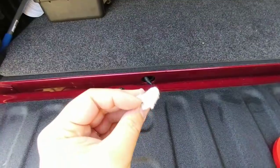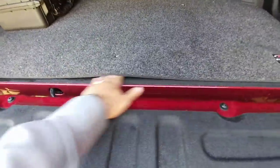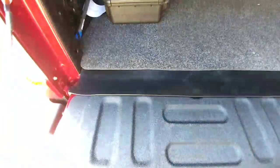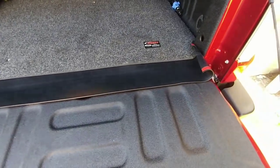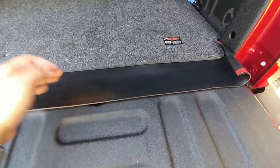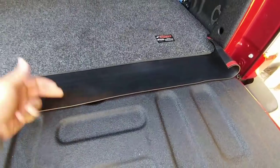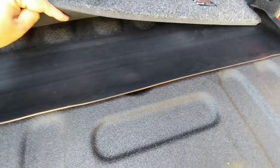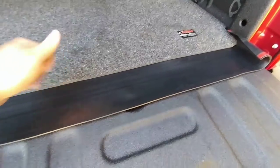Now I've unrolled the Rock Block so you get an idea of what it's going to look like once it's down. It's essentially a membrane that fills the gap here, preventing this hole from being exposed, thus protecting the paint as well as keeping things from falling back there. The 3M tape is on this side — it's going to extend all the way out about an inch over the bed liner material on the tailgate side, and on the other side about an inch to an inch and a half over the bed liner material on the bed itself.